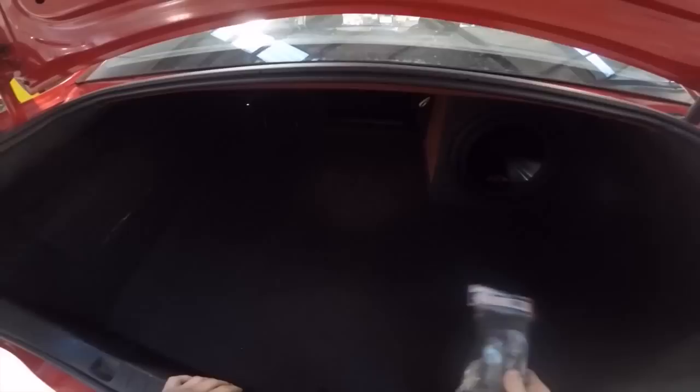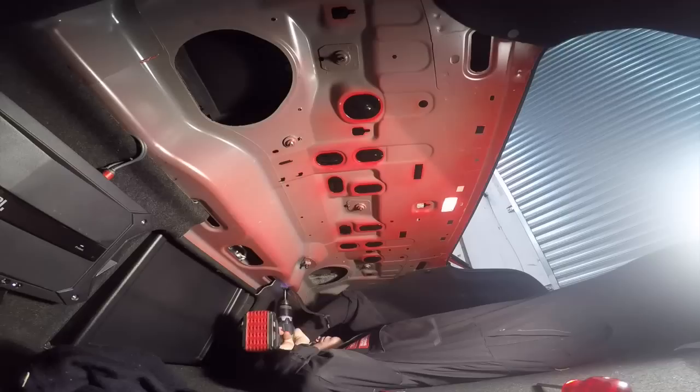The sub and amp are all in there wired up and going — sounds good. I just need to put some removable rock straps on, which are basically going to wrap around the front of the sub box and hold it in place while it's in the car so it can't fly around. They're also disconnectable with clips so you can get the sub in and out if you need to. Here's the box with the sub — it's wrapped in charcoal with a simple bed liner finish, and on the side I've had some originally brown carpet which I spray painted red to match the red of the Alpine Type R and the red of the Commodore. Then just a couple of red and black wires coming out the back with some crimps on them.